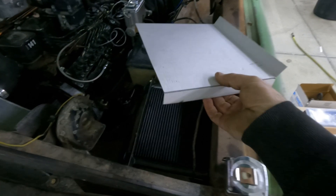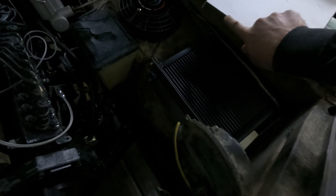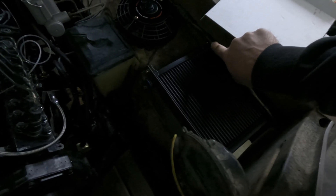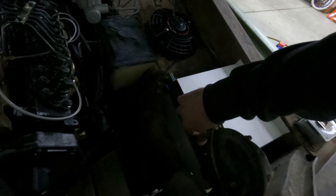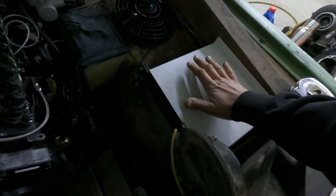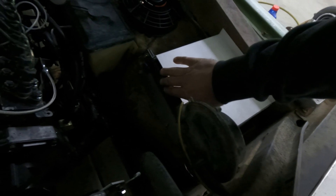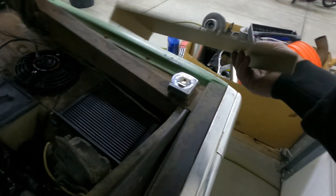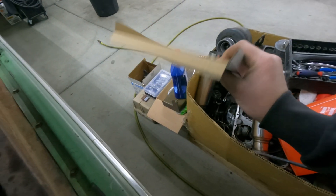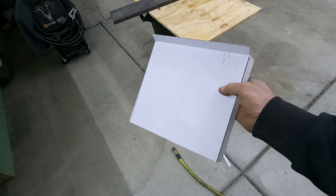This is what I've come up with — it'll sit on there something like this. I need to trace it on a piece of steel and cut it out to cover this. It'll give me some standoff to create more area for airflow across the entire radiator. This piece will rivet-nut to the inner fender and then this piece will fold down and we'll tack weld it across there. Then I'll trace it over to steel, burn it out with the plasma cutter, and cut a hole in that thing.